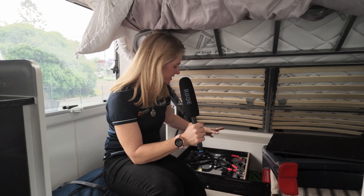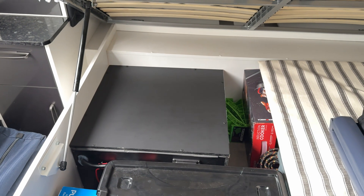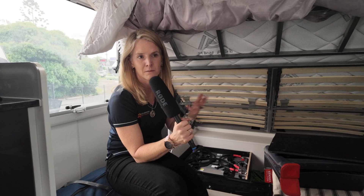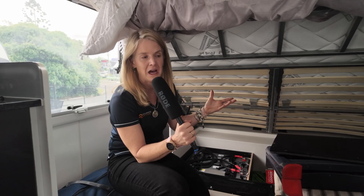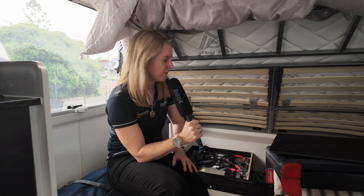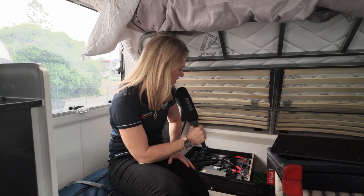For this particular build — and it depends on the build and the space we're going into — we've custom built a box to go in here and this lid will go over the top, with screws to keep it all in. It is vented to the outside. So if for whatever reason your batteries fail and there are chemicals being put out, or heaven help us a fire — we're yet to have either of those actually happen inside a caravan — it is sealed and vented to the outside. Those are the new laws that came into effect a couple of years ago.